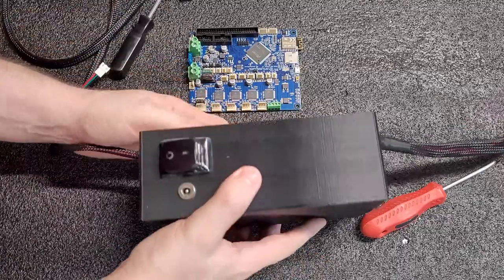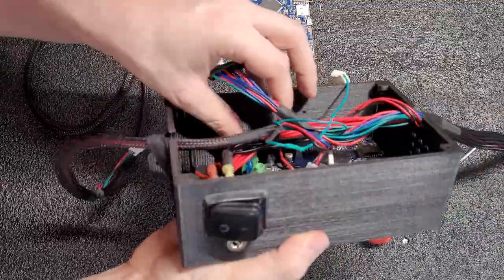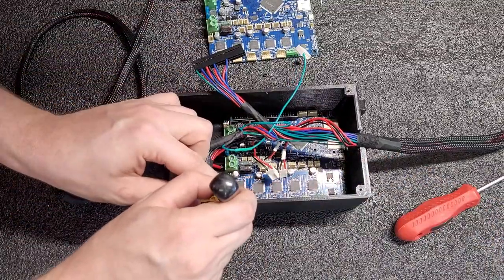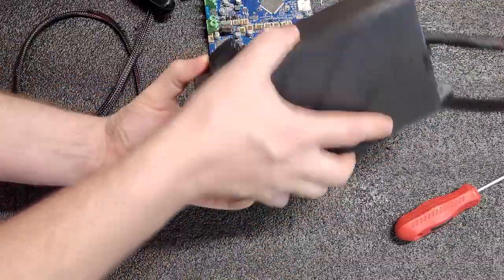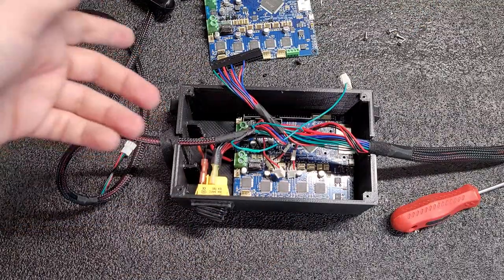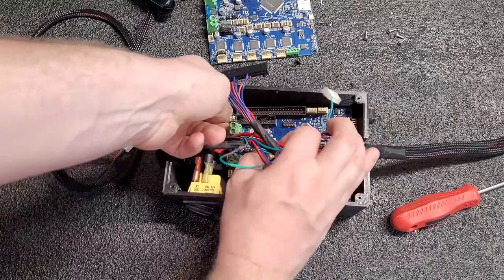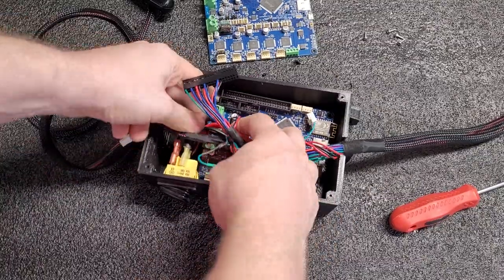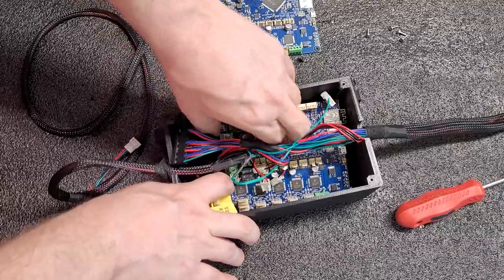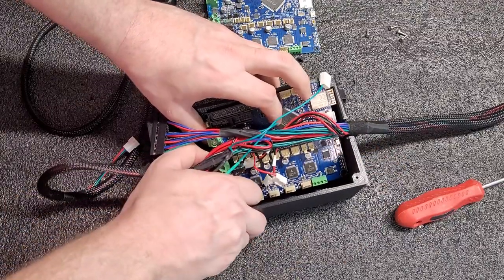Let's try and get these four screws out — try and not lose these four screws. I'll get that last screw in just a moment. There we go. I'm going to take these screws as we will be reusing them to secure the control board. Now it is time to take the board out. The best way is to maneuver it like this — start raising it up and pull these wires a little bit out of the way. If you're unable to get this board out, you can unplug the power connectors as well.